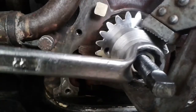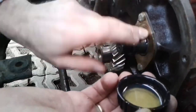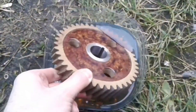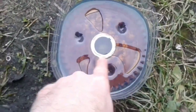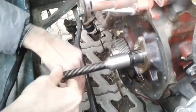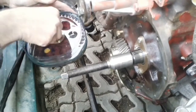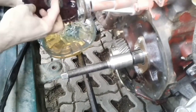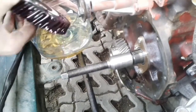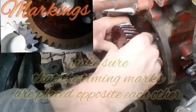We finish installing the crankshaft gear and move on to installing the camshaft gear. I decided to coat the end of the camshaft with fresh oil. The fiber gear itself I coat in engine oil for a short time before installing. Screw the central part of the tool onto the camshaft thread. The gear will run as soon as the engine starts — it needs oil right after starting, not only when it is sprayed from the jet.